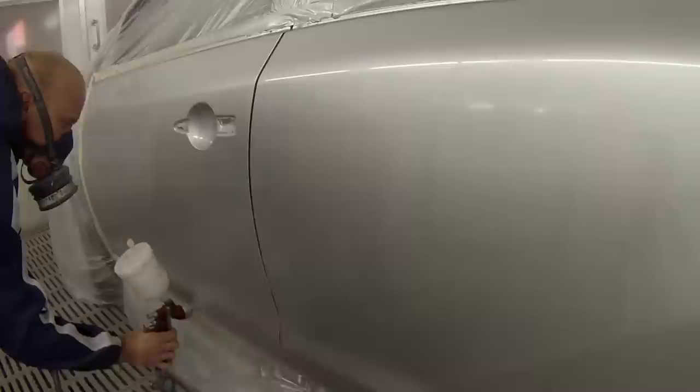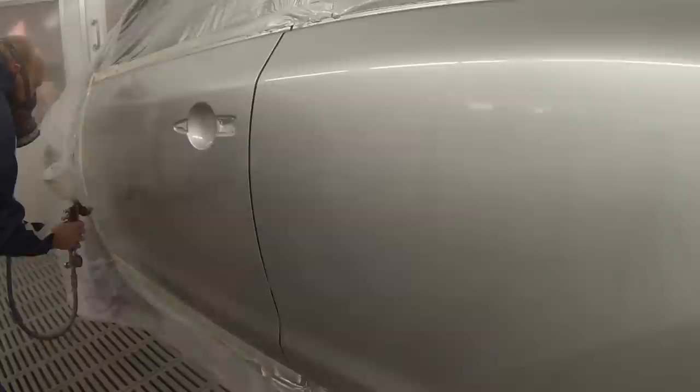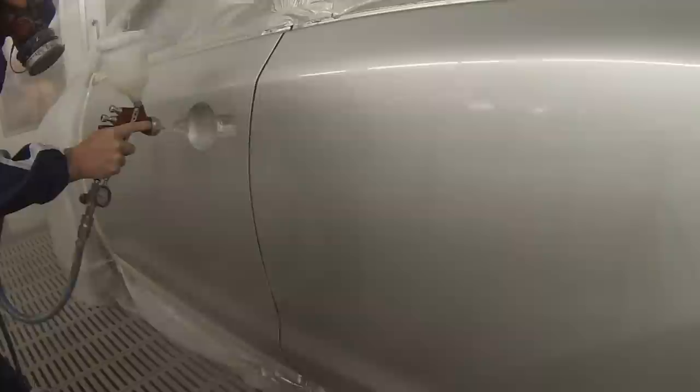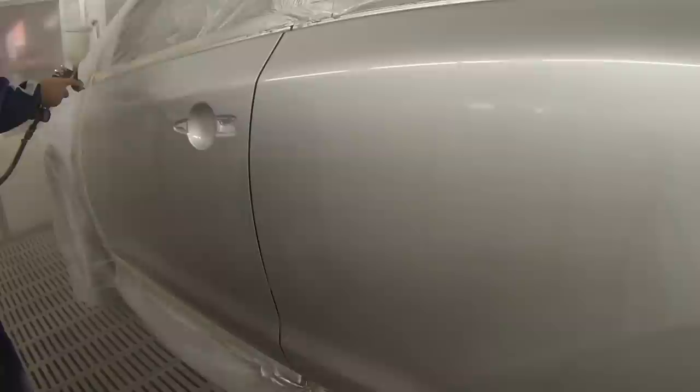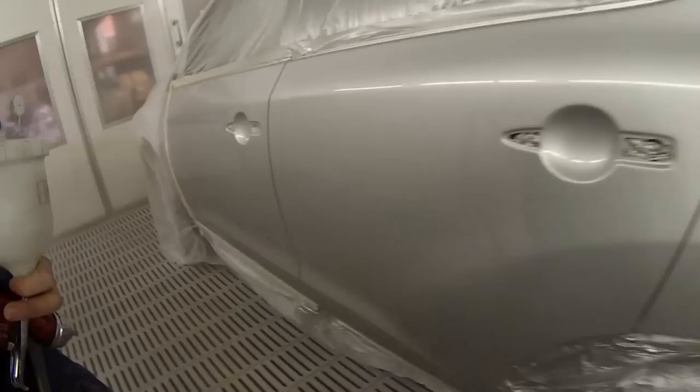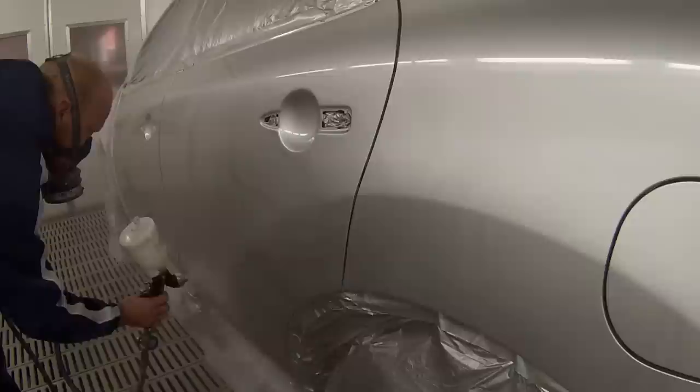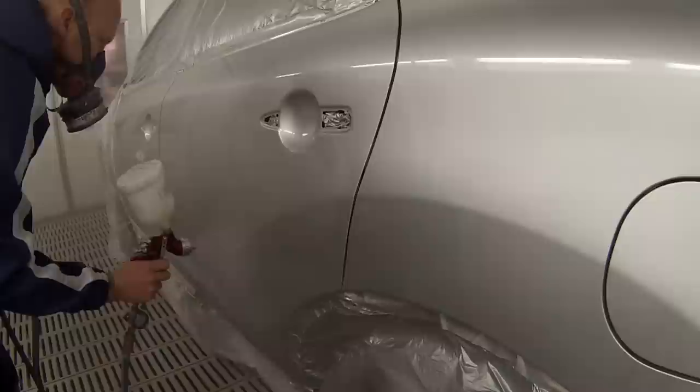You want it to flow out a bit nicer. If you put your first coat of clear on too heavy, especially on a silver like this, as I was explaining you want the metallic flakes to stand up — you can actually end up pulling those flakes back down, so you'll lose your effect, and you can actually make the blends not look right too. So it's something to be conscious of. Also notice when I come up to this door gap I'll always just paint through by about an inch and then flick it out an inch off the panel, so as not to get a big build-up on that panel edge.